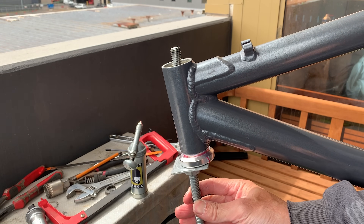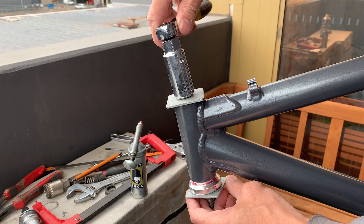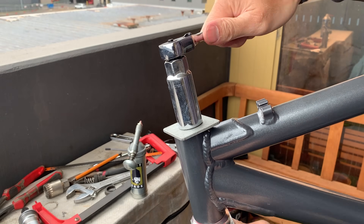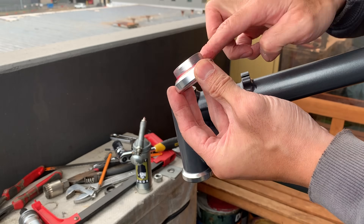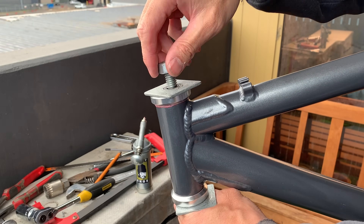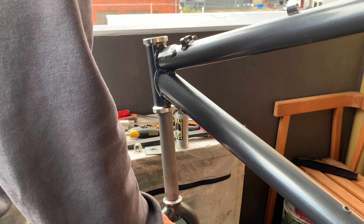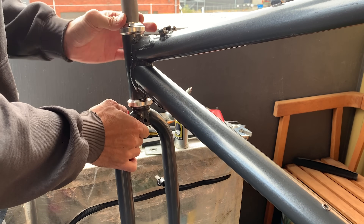Just putting the bar through two metal plates and a screw, then winding it on slowly one at a time — try to keep it as straight as possible. If it doesn't go in straight, move the bar around and center it toward the higher side to push it down. Usually it goes in pretty even. Same with the top cup — wind it on until it stops naturally against the head tube, then stop. No need to go ham on it. I picked the silver headset to match the silver seat post clamp, and I'll probably run silver seat post and silver stem too.